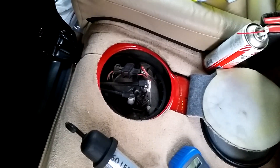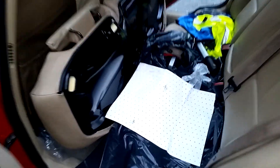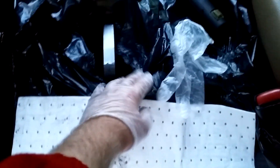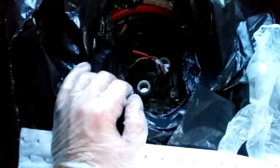This famous round locking ring is often hard to remove. To remove the fuel pump, you first want to cover the entire backseat with plastic. I've also added a piece of oil absorbing mat from the car parts store. I'm shooting this under a bit of a time crunch since I want to get this done today before nightfall.